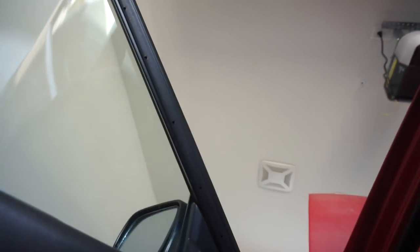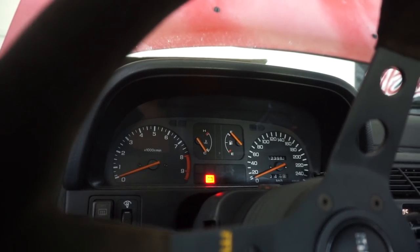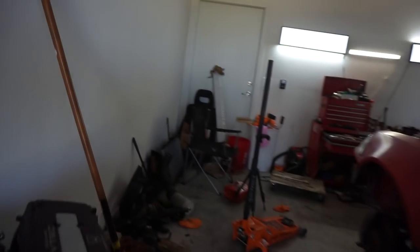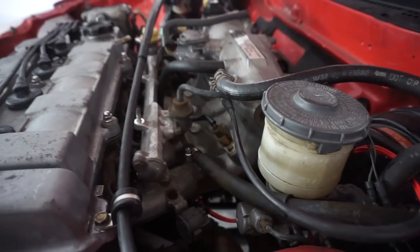So the first thing that we want to do, now normally I would probably prime the motor, which means spin it over a bunch to build oil pressure, but this engine was running a couple days ago, so it's probably fine. So what I'm going to do is see if the battery's working, scan. Oh, we have that. So now we need to check. Let's do it again. Let's check for fuel leaks. Biggest, most important thing is check for fuel leaks anytime that you've disconnected the fuel system. I would say normally I could smell it, but right now I can't smell anything.